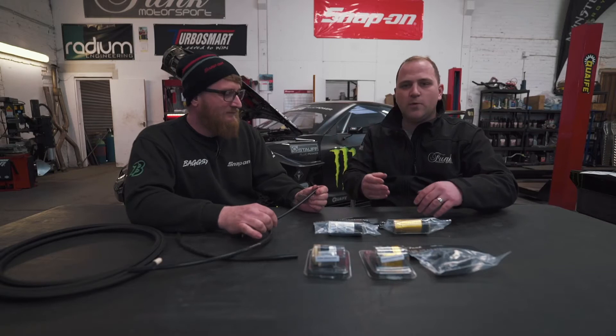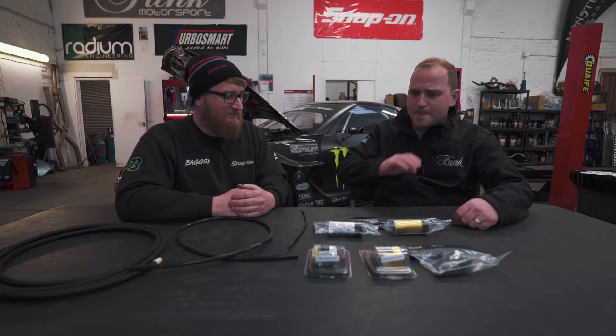It's useful in more options than that. Some people with wiring looms — it's not always possible. Some people even cut slight holes to have a branch of a wiring loom or a sensor come out. With heat sleeving, it's really just about protecting what's inside. If it's wiring, you don't want to burn your wires; you want to keep the electronic signals working as intended. If it's brake fluid, you don't want to boil that any more than necessary. Same with oil, same with coolant. We've got sizes from 7mm diameter all up to 50mm diameter. Some people have coolant pipes running very close to their turbo — they're warming up as opposed to staying cool. That's what every product is for, and if you're not sure, just hit us up and we'll point you in the right direction.